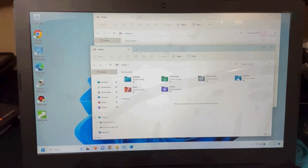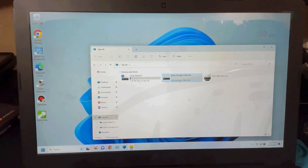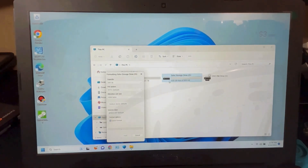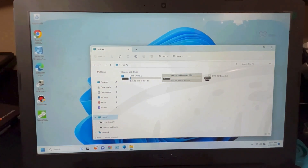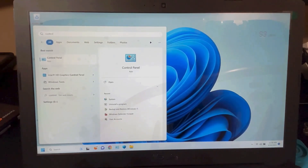From here, click on the File Explorer folder, then click on This PC and look for the drive — it's likely labeled Windows. Right-click and select Format, then label it whatever you like: Backups, Photos, Documents, etc. Click Start and this will delete everything that was originally on that drive. An advantage of having a second drive is that you can always create backups directly onto it in case your SSD crashes or you catch a virus. Go to the bottom-left Windows icon and type in Control Panel.